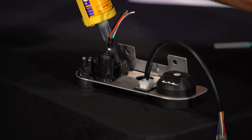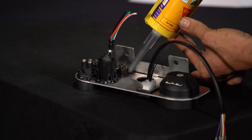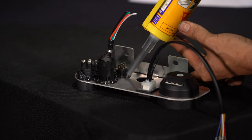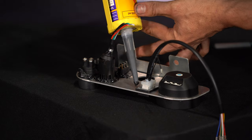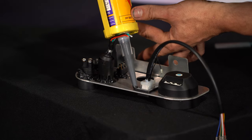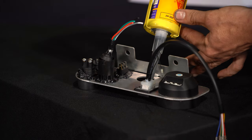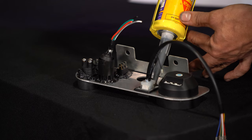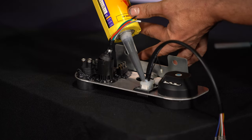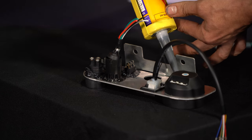So just while Brett is putting the adhesive on here, locking everything up, after we are done and everything is terminated and we're happy with everything, it's all tested and ready to run, we are then actually going to use the same adhesive to run over the top of all the terminals. It holds them in place and also stops them from coming loose or cracking or breaking or causing you any dramas, also arcing out. So we'll show that once we're up to that stage, probably in the next video.